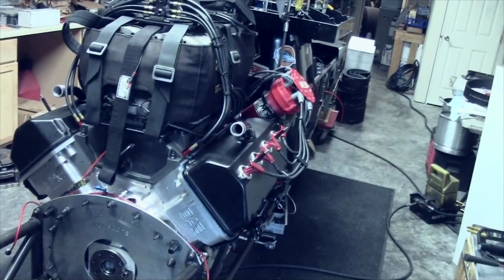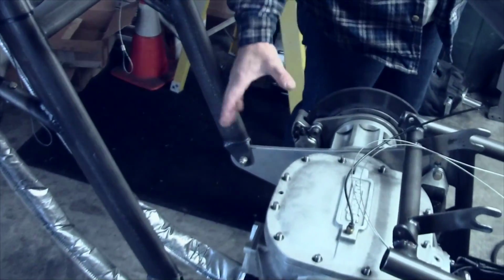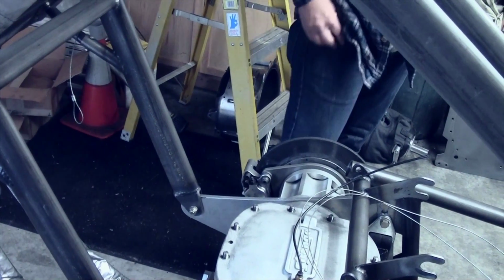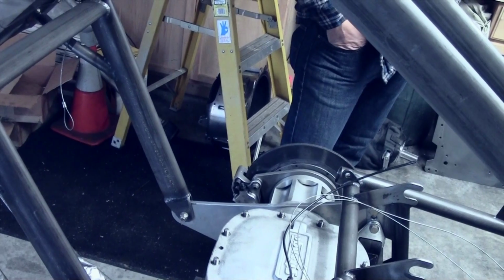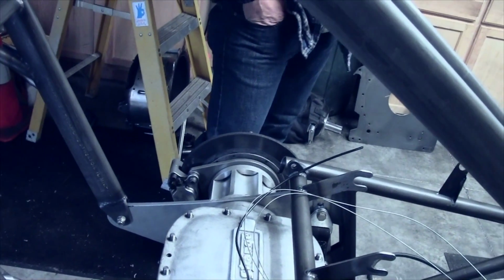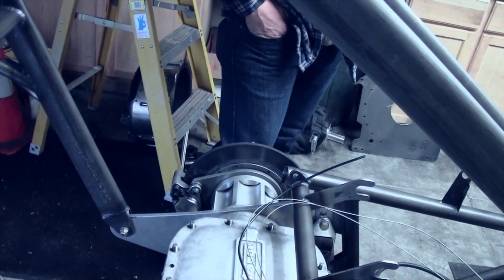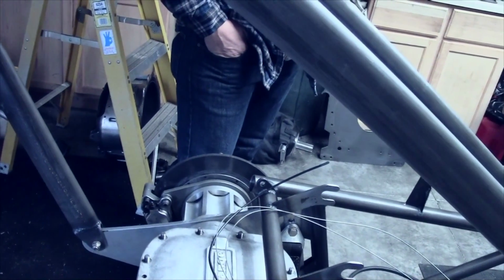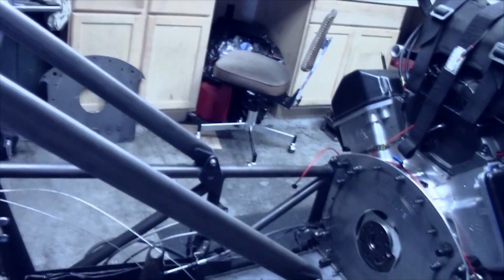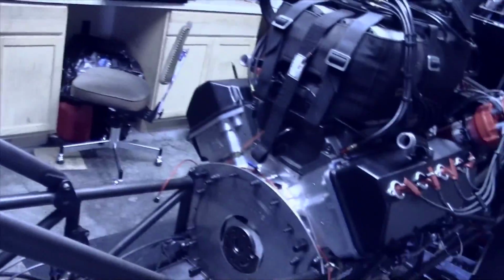Yeah, the wheelie bars on some of the cars, ours don't have one, but the wheelie bars actually have a sensor in them so they can tell how hard they load the wheelie bar. Some cars are really getting on that bar hard. So if it hits it too hard, they'll know they either need more weight in the nose or change the clutch setting a little bit. What was really cool to see was when they would leave hard on the bar, the wheel on the bar would tear the rubber right up off the track and leave a little white strip.